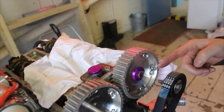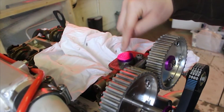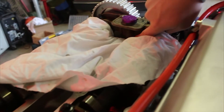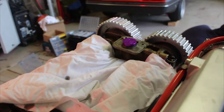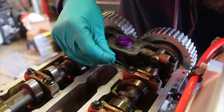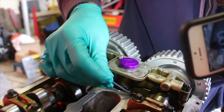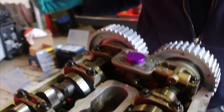Here is the VVT delete kit. Adam's just put the bung in there, but we've got to get round to the little retaining screw that you've got to pop in the underside without it falling down into the head — that's the next challenge. That's the retaining bolt that holds the little bung on. Boom — managed to get that in.